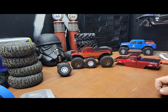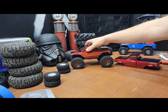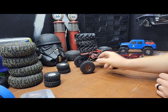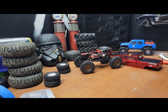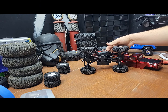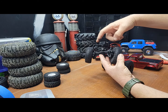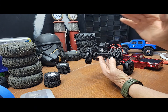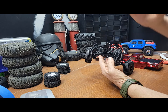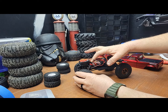I was going to lengthen the front links, so I got the rear brass links from Red Cat, but it wound up not working — for one thing, the servo runs right into the front clip. It's not made for the front links, so it was pushing the whole axle forward at an angle that is not desirable.